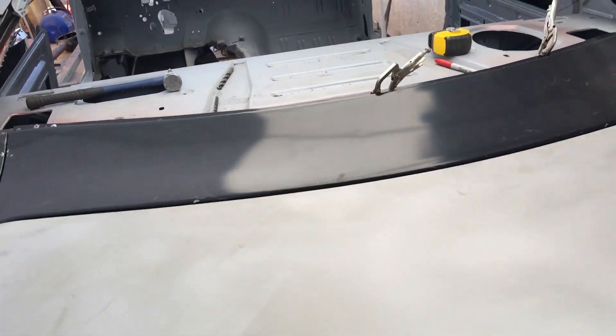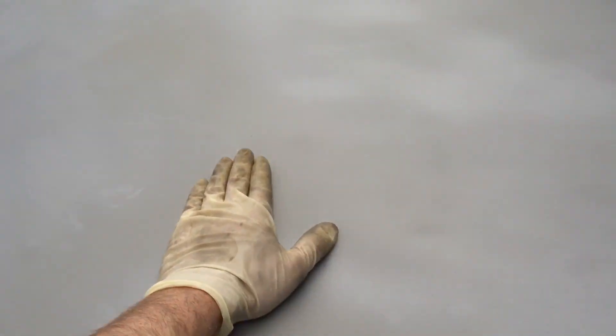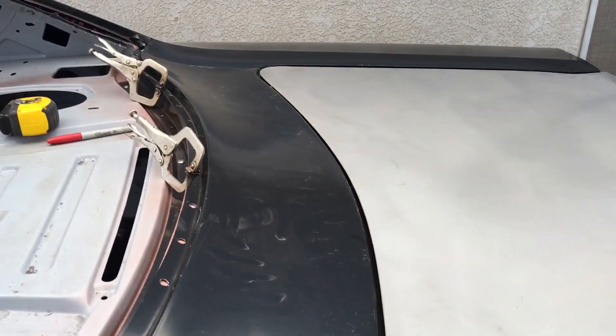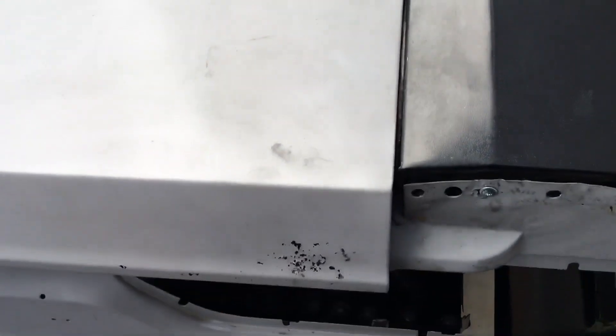Measured crossways off the front door pillars — the deck filler panel is perfectly square, the trunk lid's perfectly square. If you look at the quarter panel, that's a nice gap all the way up, and the front part is pretty even all the way up front. This one here starts off at an eighth inch just like the other side, but it opens up as it goes to the front — quarter inch up there, eighth inch back here.